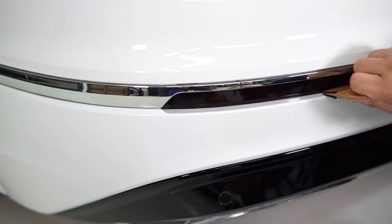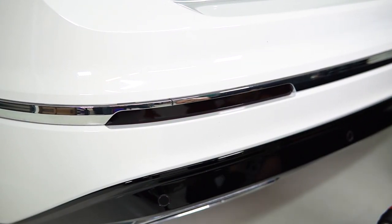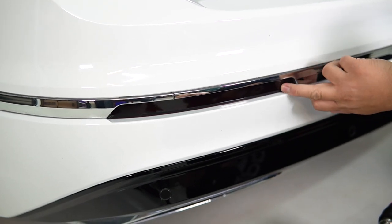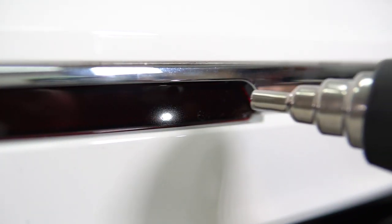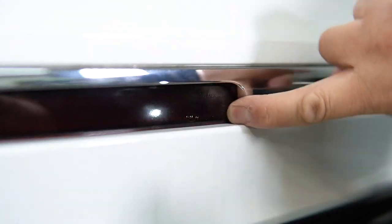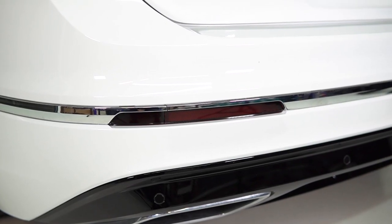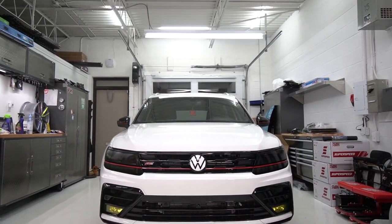Pull the masking off at 180 degrees, then do a final check on all your edges. Within about 30 seconds you have a nicely tinted rear reflector. For reflectors with lettering or molding, take a needle and poke it multiple times around the lettering, then take a heat gun to it — that will mold the vinyl to the lettering. Alright everyone, I hope you enjoyed and we didn't bore you too much with our install videos. This is what you would end up looking like. Thanks for watching.